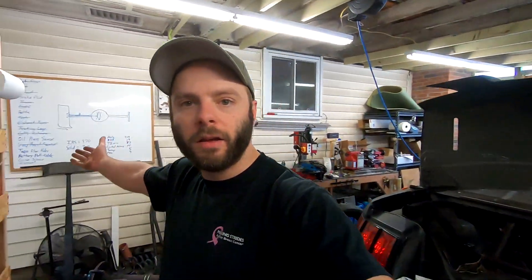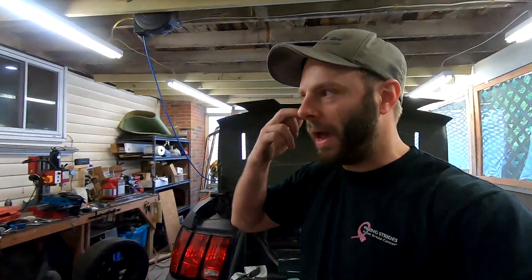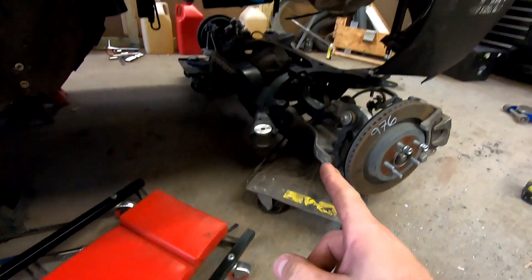If you've been watching this IRS swap series, in the very first video I explained why it's not really the worst thing. At Lime Rock Park last race I rolled across the scales at 2970 with me in the car. In ST2, you get a point break at 3000 pounds — you get an extra 0.1 power. So 30 of those pounds will get me up to 3000, plus a little buffer. I'm really only carrying an extra 20 to 30 pounds, all centered around the rear axle, really low in the car. I think the performance gain will far exceed the slight weight gain.